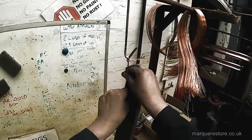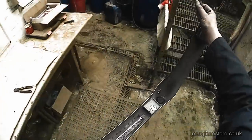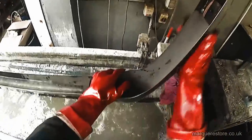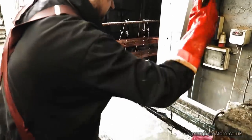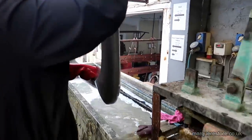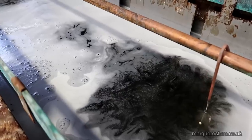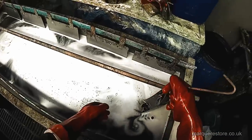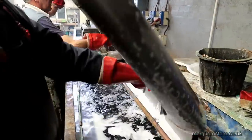Now this bumper's having its first visit into the plating shop. We've got to wire it up onto copper wires so that we can pass an electric current through it. This tank here is a soapy cleaner — as plating is all about cleanliness, we're going to give it a good scrub and make sure there's no traces of dirt or grease. This next tank is where we pass a current through it, blasting any oxides off of the surface, because any oxides whatsoever will prevent the plating from adhering and you're liable to get plating peeling off.